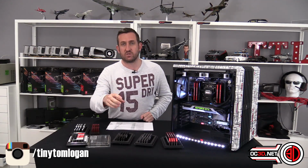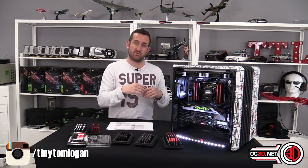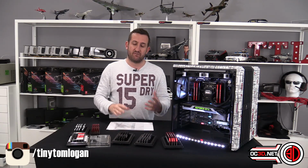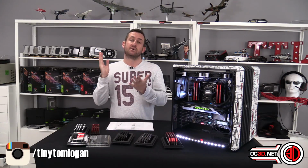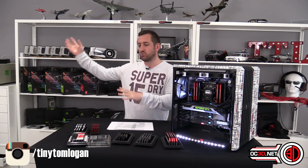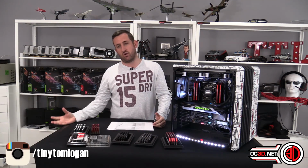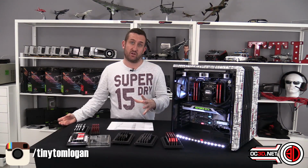If you are using Windows 7, or trying to use an old M.2 installation of Windows 7, you need to remember that Windows 7 doesn't have the drivers built in for M.2, so you'll run into a lot of problems trying to get it installed on any M.2. It doesn't matter whether you're on Z170. There are kind of backwards ways around it, but I'm just trying to be very clear. Windows 10 and you're not getting the M.2, you just need to have a look at the BIOS.